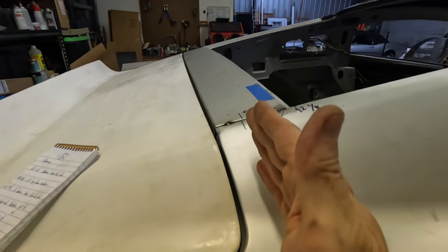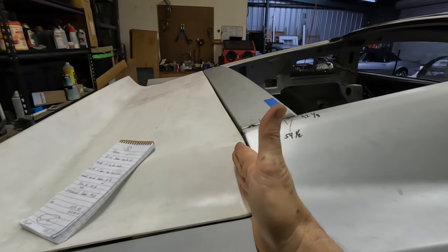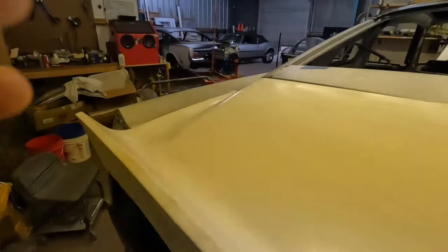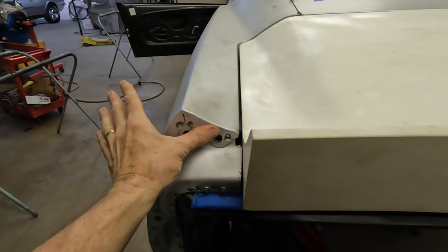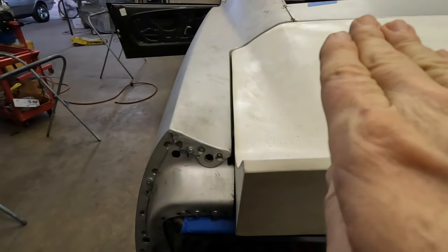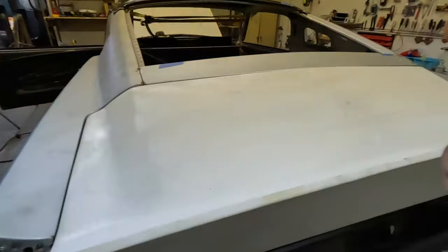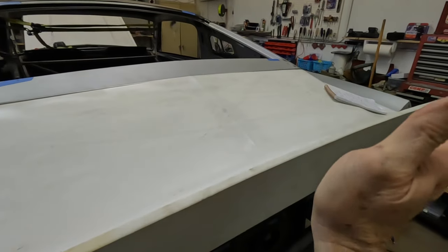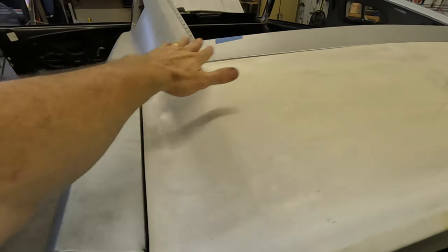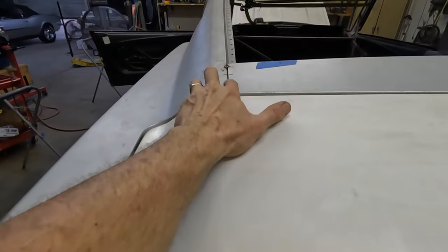Prior to that, when I tried to align everything and put the trunk on the car, the trunk had to sit further back here, so this gap was getting affected. And then this gap on the backside of the car was very tight in the corner — because the trunk instead of sitting straight was tilted. So the gap was not straight. By fixing that corner and moving that piece up, it gave the trunk lid a chance to go up a little further. I was able to get the top section to fit well, because you're just pulling the quarters in tight to this piece here — you don't have a whole lot of options, they've got to be tight on both sides, which dictates your opening.